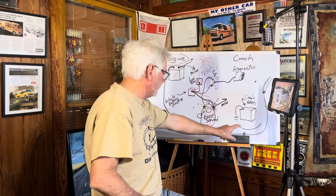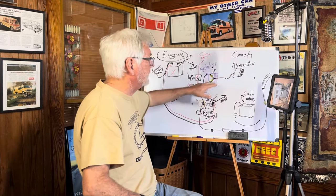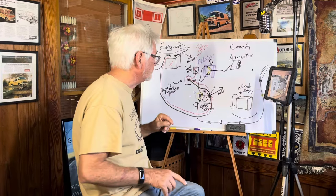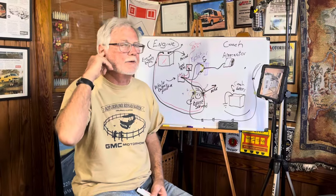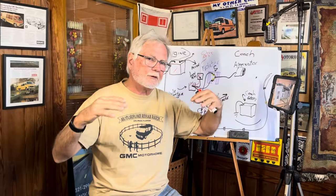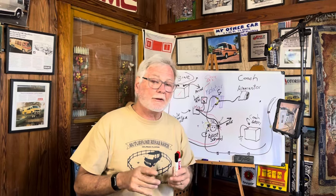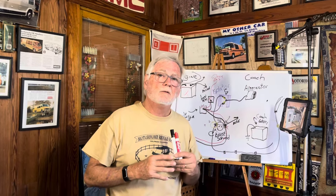We are still not talking to the living area electrical system at all — all we're talking to right now is your engine electrical system. Air riding: if you lose air pressure, you really are pretty much done and should not drive. When the back of the coach goes down, the tires get very close to the wheel liners. In '73s and '74s, they actually crack the wheel liners. On '75 and on, you'll see a little cutout, but it will still go down on the tire. If you have any tire bigger than a 225/75/16, you will crack the liners. Air is a critical, mission-critical system.